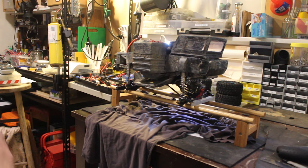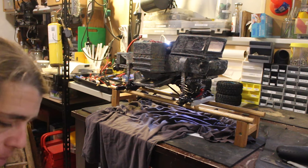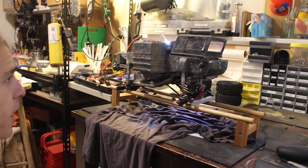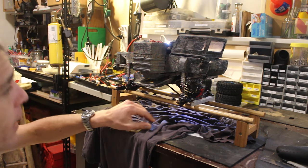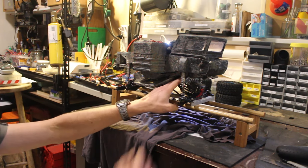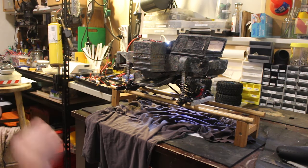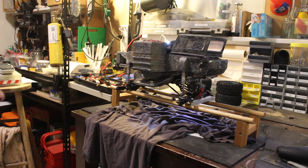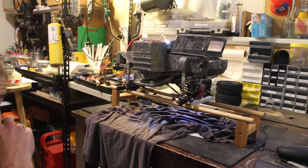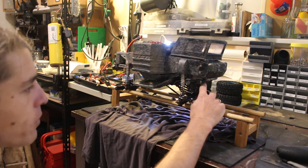I might actually use the weights that I got out of my scavenging video from the base of the vacuum cleaner's charging tower and get one of those here. I might not use one at the front again for servo clearance. I wouldn't mind trying to run it with shorter springs, or weaker springs, or no springs maybe, just to see. But then I'll be riding quite decked, and I don't want to abuse that lovely servo I've got in the front here.